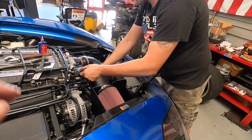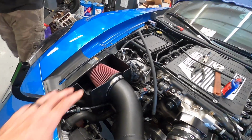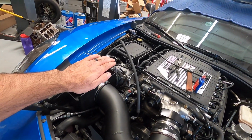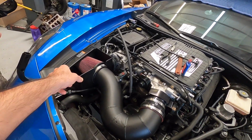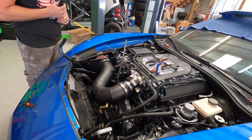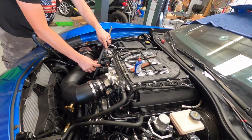Looking really good. We got our 5-inch intake on there. Got our hole cut. That hole is all cut out. Normally, most of the cold airs that we would recommend have a cap on that, so we're not getting any underhood engine air, but this one at speed will get some pretty good cold air there. Big old Nick Williams 103mm throttle body. That looks fantastic on there.